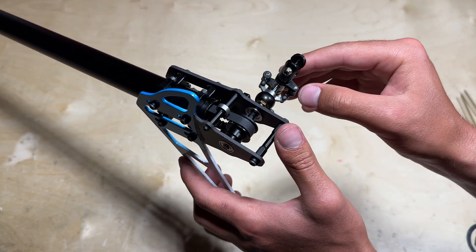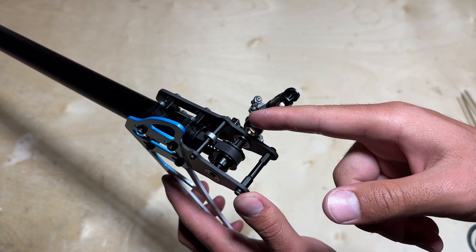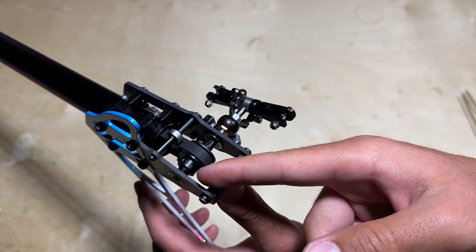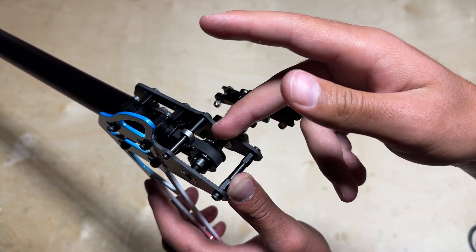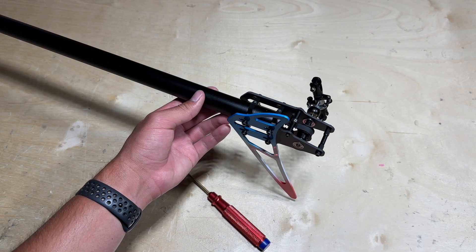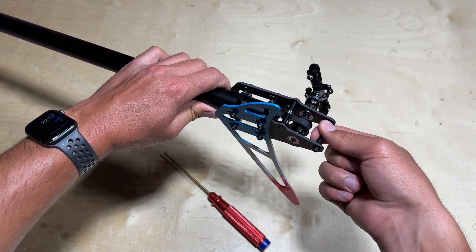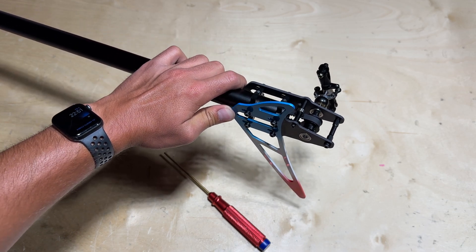With those three shims installed, you can see that there's absolutely no back-and-forth play in the tail shaft anymore. One thing to keep in mind is which side of the tail belt pulley the belt likes to favor. In this instance it's riding on one side — whichever side it wants to ride on, I like to put the shims on the opposite side. This offsets the pulley just a little bit to help the tail belt not ride so far to one side. It doesn't have to be perfectly in the middle; you just don't want a lot of tension on one side. The last step in the tail assembly is to tighten up the tail belt tension through the four screws on each plate — eight screws total — pulling back on the two plates to get tension on the belt.